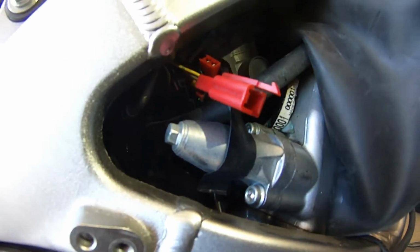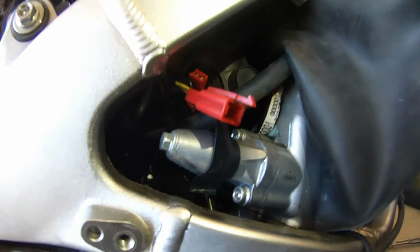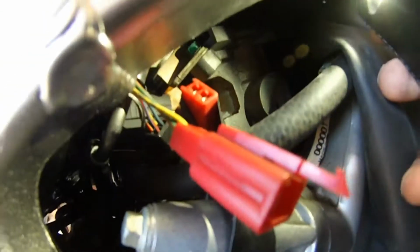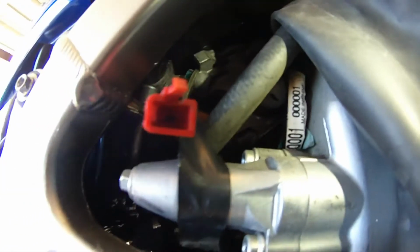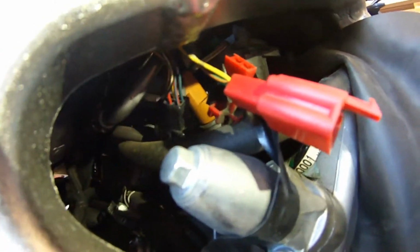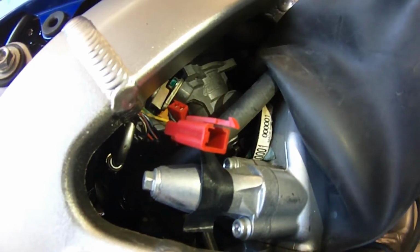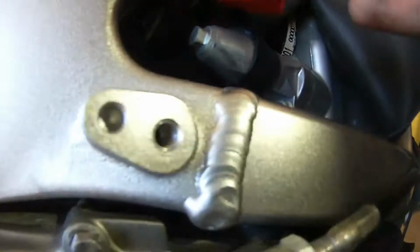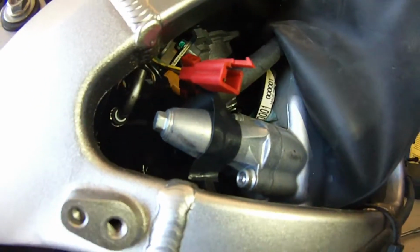So what we'll be doing is applying the 12-volt battery voltage to this. The positive battery voltage will be attaching to the yellow line, as you can see there, on the right hand side here, and the green-orange, which the negative terminal of the battery will be connected to, is on the left hand side over here. To keep things simple, just basically the solid yellow running out from here goes to the yellow here, and the yellow white stripe goes to the green orange.